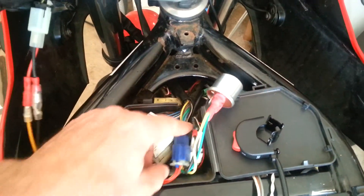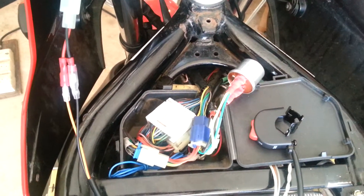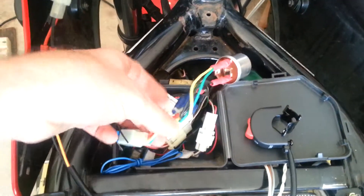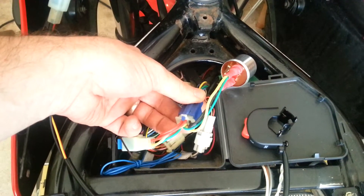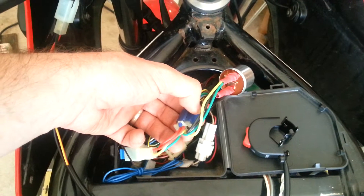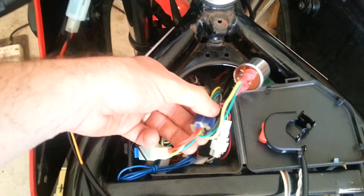I always like leaving things as they are and not chopping and changing cables. If I need to change something, then I'd prefer not to have to chop it back. So I designed this little intercept here. This blue connector is the left-hand controls — the headlight, the main beam and high beam, and the left and right indicators, and also the choke switch, so that when the choke is on, the bike engine control knows about it. I don't need that, so I've repurposed those wires.